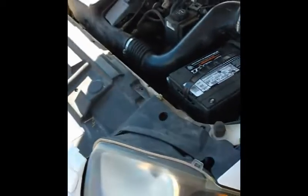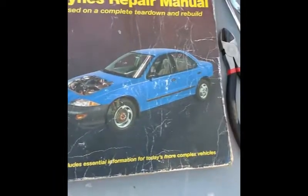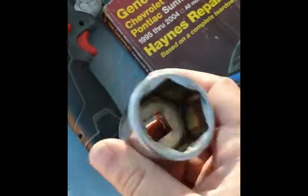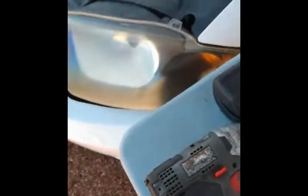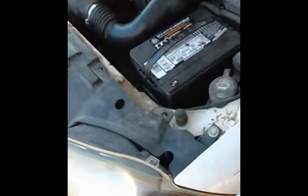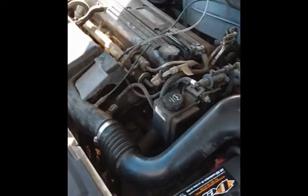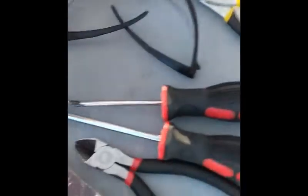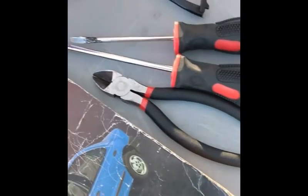What you're gonna need for this job: it's a good idea to pick up a repair manual for any vehicle you own — it'll have all your torque specs. You're gonna need a one-and-a-quarter-inch socket, which is the same size as your oil filter. You can check that out in the oil change video on this channel. As for taking the valve cover off — which you do need to do for this job — that's also covered in another video on our channel. We do have a rubber gasket and it's very reusable, so you really don't have to replace it.